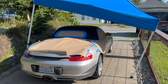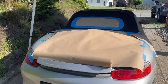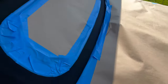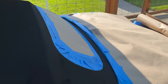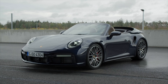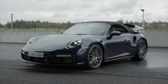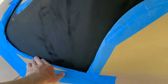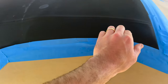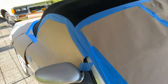I don't have a garage to work in, so I did my best to shade my area and mask up the car, but if you have a garage or a controlled area it'd be much better. A tip I would have is if you can lift the convertible top slightly, tape it off, tuck in the tape, and then set it back down — as long as you can get a good tight fit around the plastic and rubber. You don't want this stuff to get on the car at all.